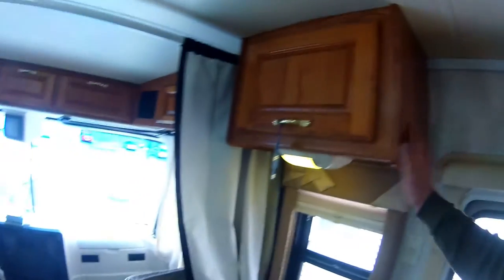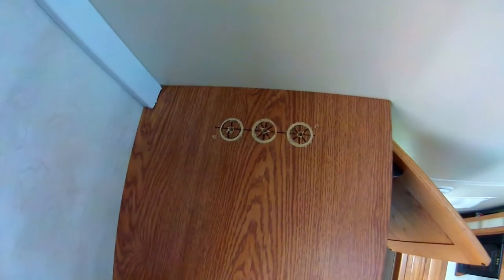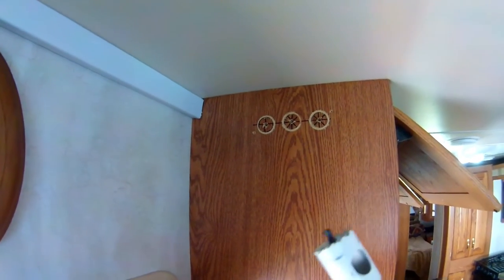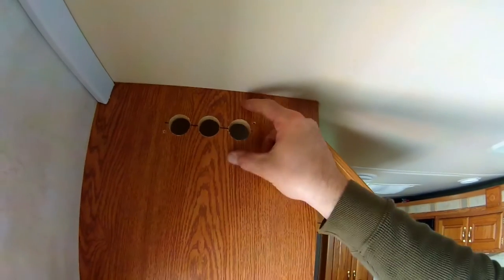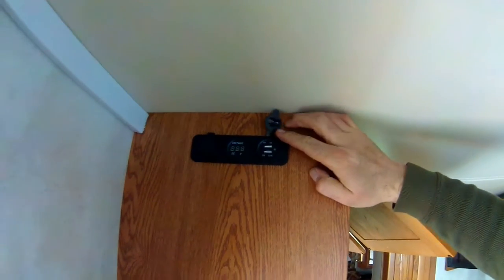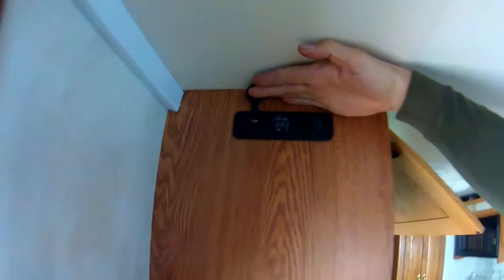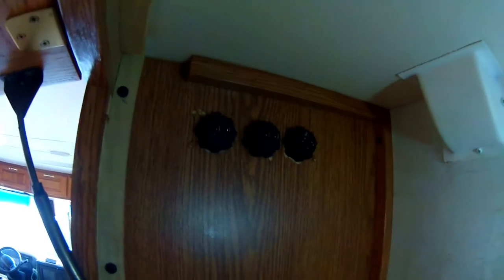To solve the problem on this side, I decided to put a 12-volt socket in the bottom. I put the plate on first, then took it off to score the center and make sure it's level. Using a hole saw — I think it's an inch and an eighth or inch and a quarter — we'll drill the holes out. Three nice holes drilled; I used two little screws to hold the plate as a template while marking. We have dual USB ports — 1A and 2.1A, five volts — a DC voltage display, and a standard accessory outlet with dust covers. It looks really good.